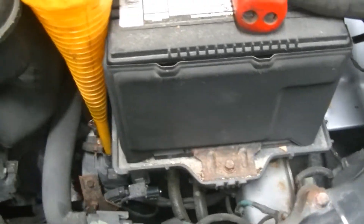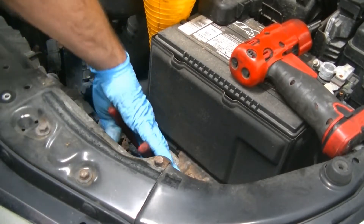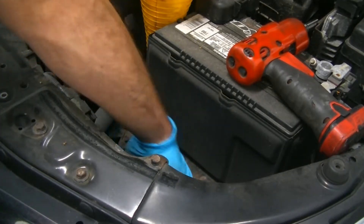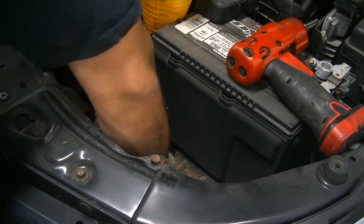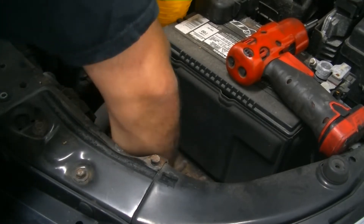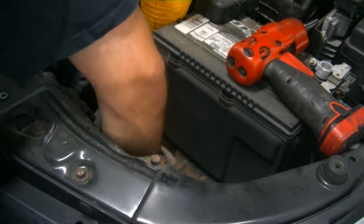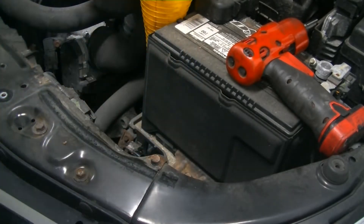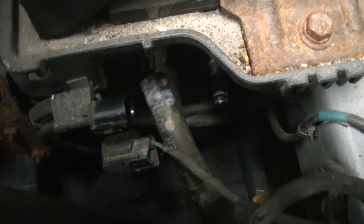I like to do all my prep for filling it before I even drain it. We're going to get right down here with our pliers, pull this clamp off, grab the hose, give it a little twist to break the seal, and it will pull right off with a little bit of elbow grease. Just like that, we disconnected one of our cooler lines.